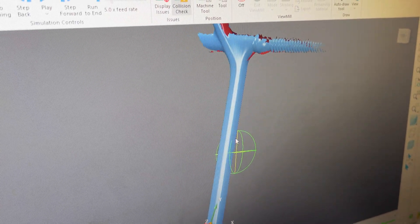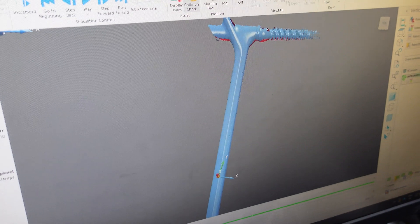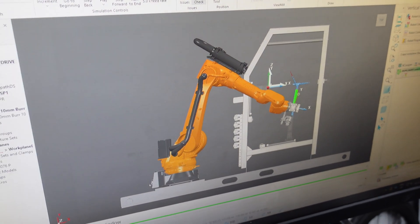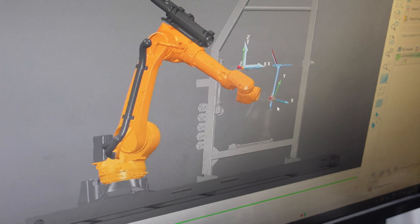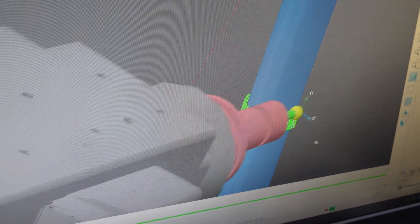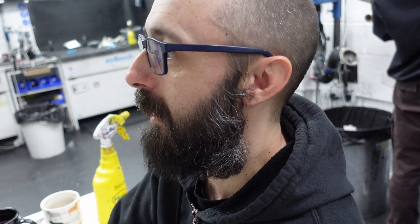Here you've got the digital version of the frame that's currently in the robot scanning away — it's a pretty nice scan. What we do is lay the tool path on top of that, which are the green lines. If I zoom right in you can see each individual line — this is the tool path and the robot head basically follows each individual line around the frame. If I change the graphic and turn the robot on, we can run the simulation, which is what you have to do to get the data. You can see it going through one pass at a time.